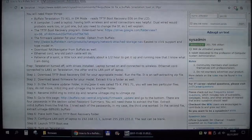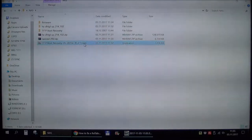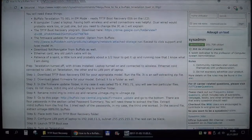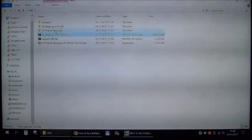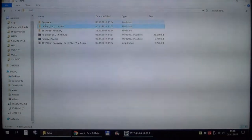Okay let me tell you the progress I've made. Step one: I downloaded this file — it's an executable, so it extracted into this folder, which is exactly what should have happened. Then download the latest firmware. It was a zip archive — it extracted here. We need these two image files; they are the biggest in the archive. We copy — not move, copy — them to another folder, which I called "firmware".